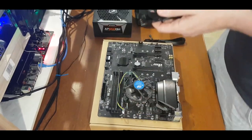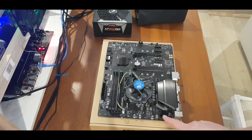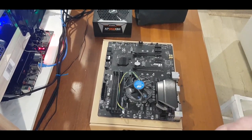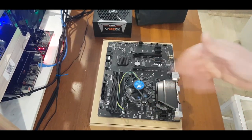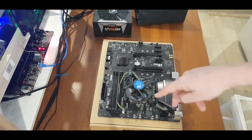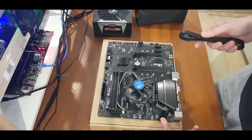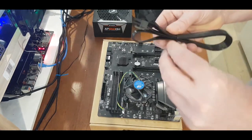That doesn't. So some of the newer motherboards now have 8+4, 8+6, 8+8. Motherboards are becoming like some of the bigger GPUs as they're getting more and more power slots, which is kind of fine. But generally for mining, the fewer power cables, it helps with cable management, and if you've got the capacity, you can feed more GPUs if you're not committed to putting so many cables into certain components. Anyway, the Z390's got an 8-pin slot, which is great. So let's unwrap this.